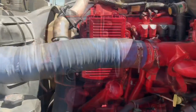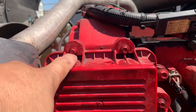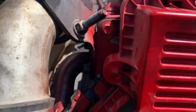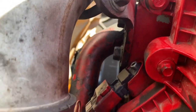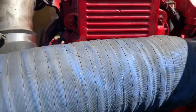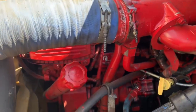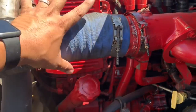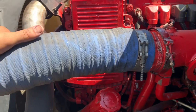And there you have it. I didn't really show the process of putting this back together, but the bolts are a 5/16th. You replace your sensor — there's your sensor and your plug, literally it's plug and play. There's nothing to it. This hose — if you take it out, this is your CAC hose — take it out from the clamp, move it out of the way, get to your filter, put your new one back in. Put everything back literally the way you found it.